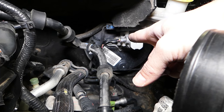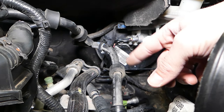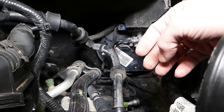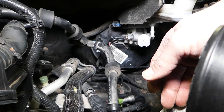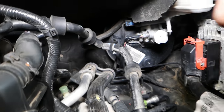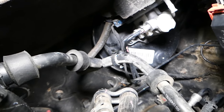You can see that's your brake booster — the brake pump is connected to the booster, and on the other side of the booster is where your brake pedal is. That booster has membranes inside. When vacuum activates the membranes, that brake pedal feels really nice and soft, and you'll be able to press it and have good braking power. If there is no vacuum, that booster will not work and you will have a hard brake pedal.